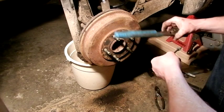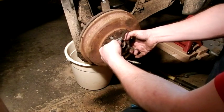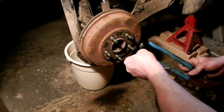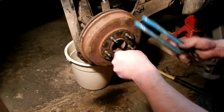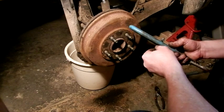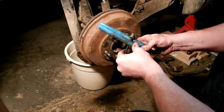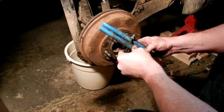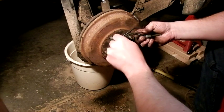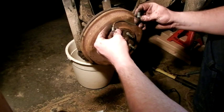Now I'm just bending up the new brake line. My favorite method of bending this is to use a pair of channel locks with some nice soft rubber handles — just slip it between them and you start bending. You've got to be careful though, because you want to put your bends in specific locations. I've been frequently checking it against the original. Now we need to install this.